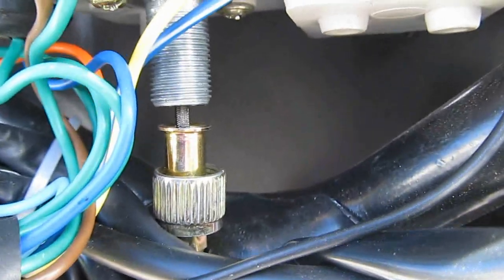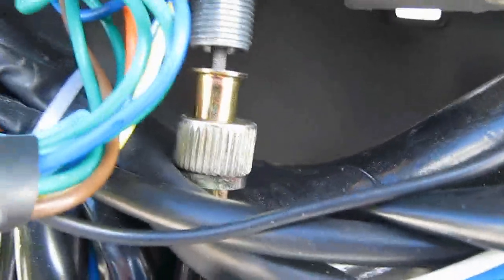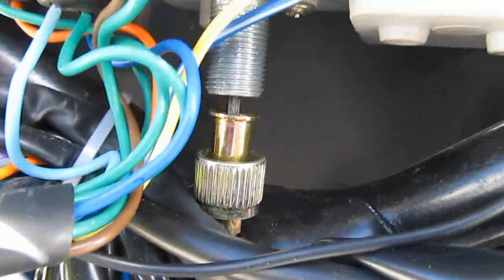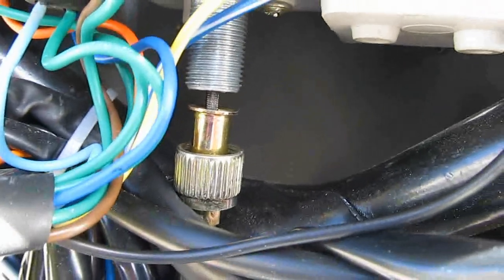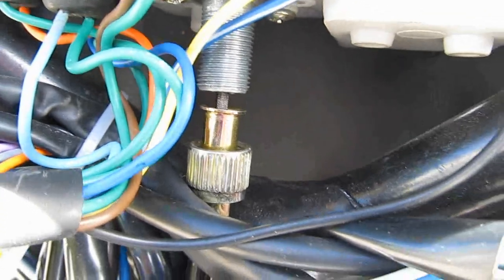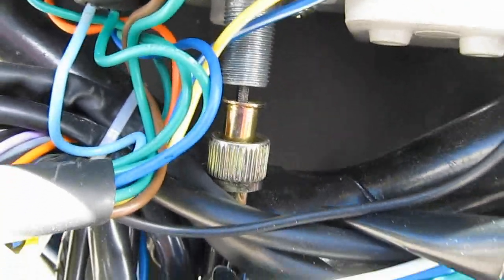see there the cable. And if I spin the wheel I don't get any movement at all. So what that tells me is the cable is broken somewhere between the wheel and the speedometer gauge, so I have to replace the cable.